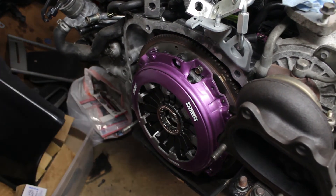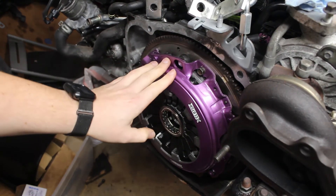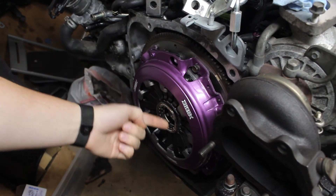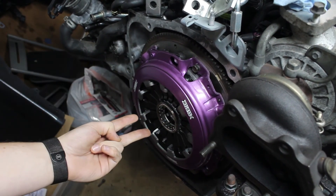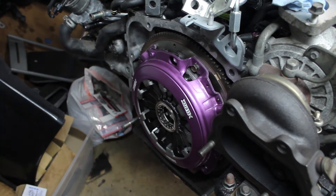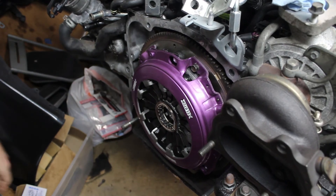This is actually the wrong clutch. It was a listing mistake by Rally Sport Direct — they listed this clutch as fitting my Legacy when it actually doesn't. It is a pull-type clutch, as you can see from this ring here; the throw bearing actually clips into here, and when you press the clutch, it pulls on the clutch fingers instead of pushing. That's not the right type for my transmission — I think it might have fit the 6-speed Spec B, but they made no distinction there. So I've got to pull it off.